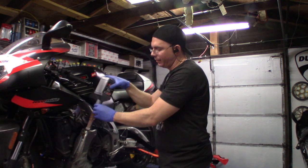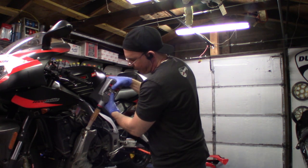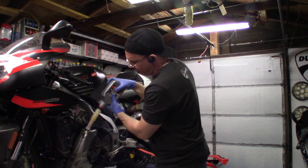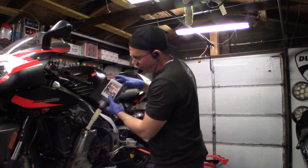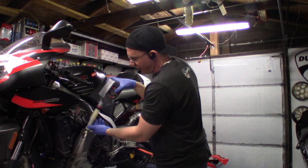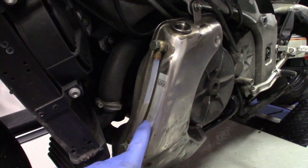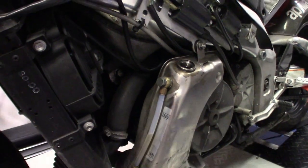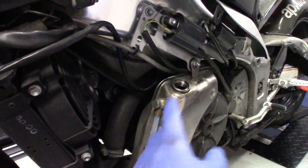We're on quart number three — it should start showing up on the line after the third quart. Don't freak out if the line shoots up to your measurement because the engine is going to pull the oil in. These Rotax engines are almost all designed the same — from the Buells, my EBR 1190SX, the KTM RC8, the KTM Super Duke — they all use those type of engines. With three quarts in there it's showing about halfway where it should be, but as soon as I run it it'll suck that oil in. I'll put another half quart in and it'll suck it back into the engine.